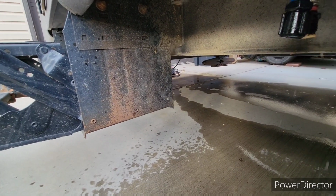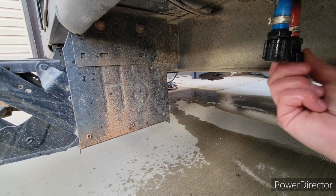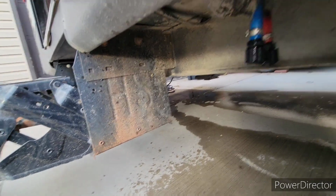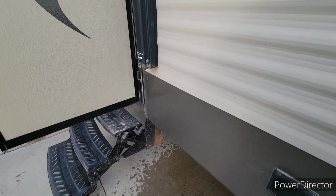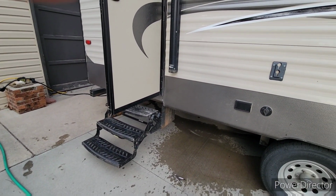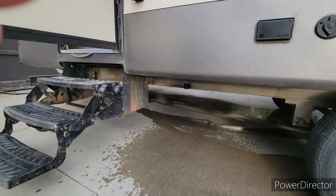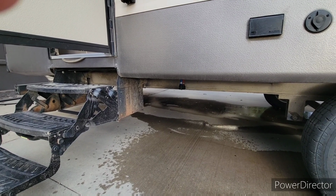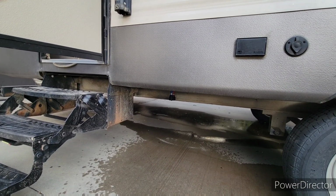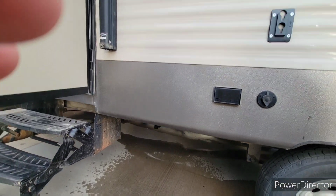Now, you're basically done. You're going to have some water in your tanks from everything we've done. So what you can do, in your fresh and your black, is either drop your tanks so you don't have any of that water against your valves, or you can put antifreeze in your gray tank and into your black tank, which is what I do. I'll show you that.